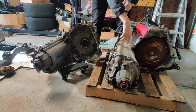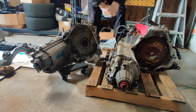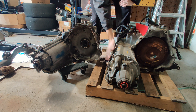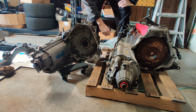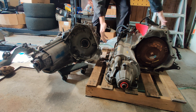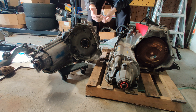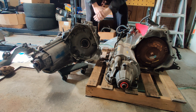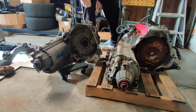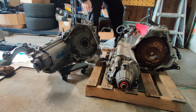So this will have to be figured out on the engine side of things once I get that mounted up. The transmission is normally mounted on the backside of North Star cars, so the back and the front both have mounting positions. On a W-body the mounting positions are on the side and the top, so I'll take a look at the side over here that I'm going to start with — probably the most difficult part to figure out.